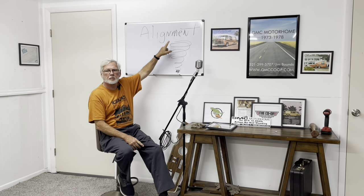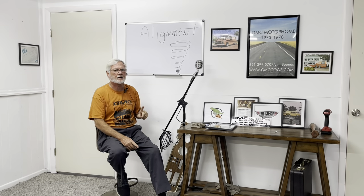They will all run this way. It's not like, well, mine runs great and mine's terrible — why is that? They all will drive that way if you set it up right. And the alignment is not the black hole of Calcutta. It's not a black hole. Well, I have these specs, so I'll put on this sway bar thing and man, that just solved it all. That's called throwing stuff against the wall to see if you can fix it. Go back to basics. Are all the parts in good shape? Is it set up right? Is it aligned well? If it is, it'll work. That one I can guarantee you.